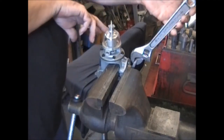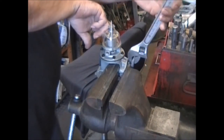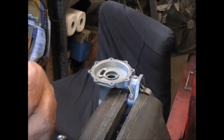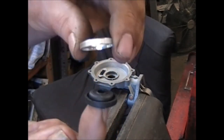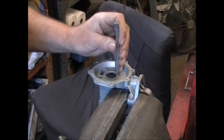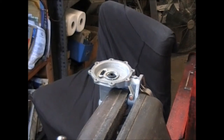The inlet is over here. Put the arm relaxed, put your finger over the port, pull the arm up, and you should feel resistance there. Hold it up, cover it, and you'll feel pressure going out. Vacuum side — seal goes in the same way as the fuel side. Retainer, seal with the dome up. Press it in. Dimple around the edge just to keep it from sliding out. A little spot of oil in the center, just like the other side.